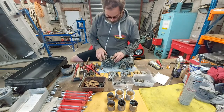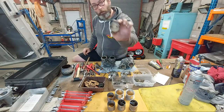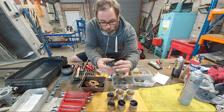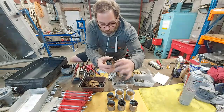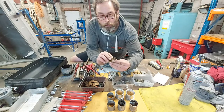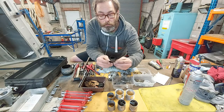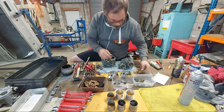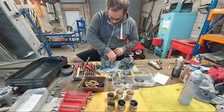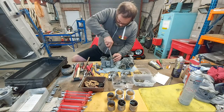Okay, now we can remove our butterfly throttle valve disc. These are specially machined, guys, so they're machined to angles so they can seal the bore. Okay. That's one. I'm going to do the other so I can take the spindle out. Let me just get through these quickly.